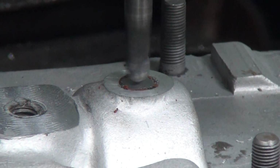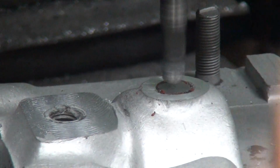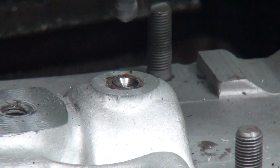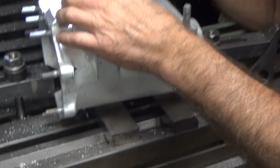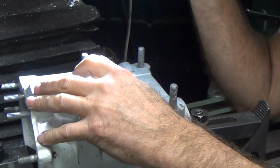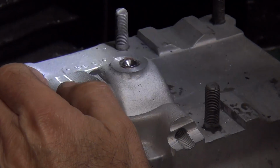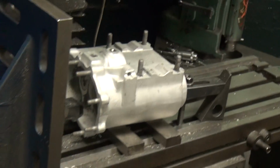Tell us what we got to work with. Wow. Oh man. That was hard. Do you ever spray oil on it while you're drilling? If you did that with this, you'd be a big smoke storm because this is going to be very hot. It's going to be very dangerous, because this thing is going to want to dig in and snap off. Maybe that's why I broke 5 drill bits. So I would recommend you stand back a little bit. Use the zoom function.